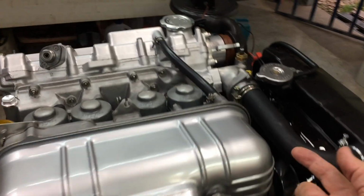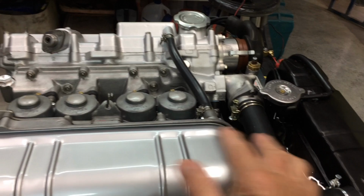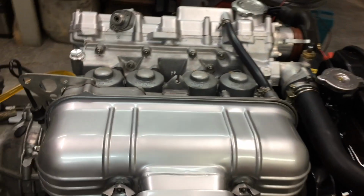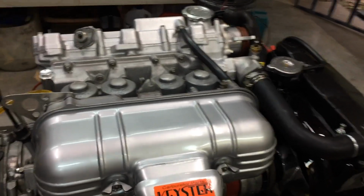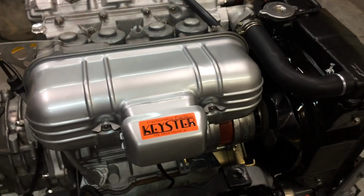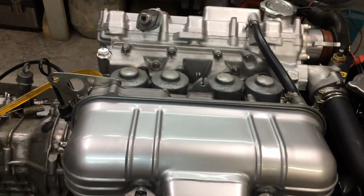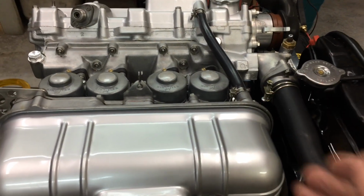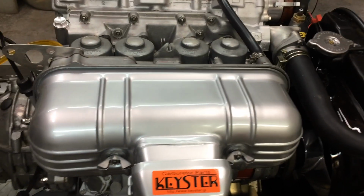But where the fuel flows in, there are those wide O-rings, and then an O-ring goes inside that. There's four of them, right? I don't think it needs those little O-rings in the middle. Does anyone know anything about that? If they do, let me know. I really can't see why they're there. They do restrict the flow of the fuel as far as I'm concerned. And like I said earlier, unless I've deleted it, there were four. Then when I took this off, there was one missing. This carby here, with the O-ring, had turned sideways and was jammed in the flow hole. Another one was jammed back into this thing, and only one had stayed in place. And like I said, it ate one somewhere.